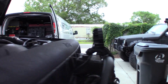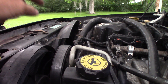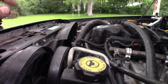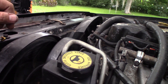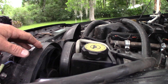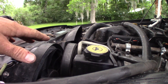I don't know what I was thinking. Anyway, like I was saying, that is the way to go. 98 ZJ clutch. Stock fan. Can't nothing beat that. I don't think you can run it with a three-core radiator — it possibly would hit. I got about an inch and a half between that and the radiator. I know this works. I've used it for two years and not had any issues.